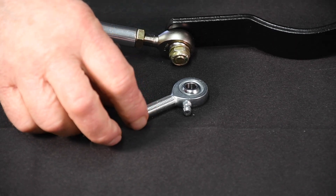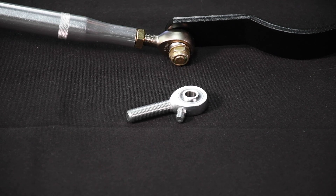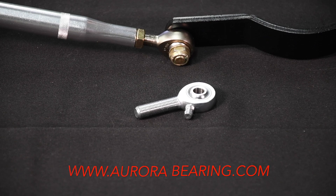There are certain rod ends available that are built with internal grease fittings, such as this example from Aurora. The catch is the grease fitting will physically weaken the rod end. One concern is the problem of dirt being attracted to the grease — grit eventually finds its way in between the ball and the race and then wear escalates, sometimes rapidly. But in the case of a clutch linkage, much of it is relatively well hidden or protected in the car, and as a result you can probably get away with a Zerk-style rod end. They're certainly much more economical than the three-piece Teflon job with chrome moly components.